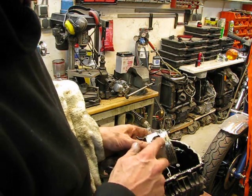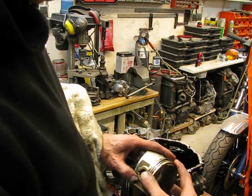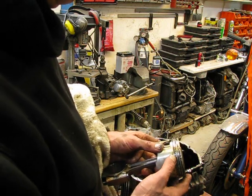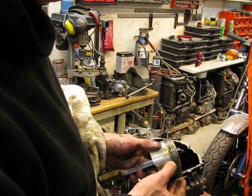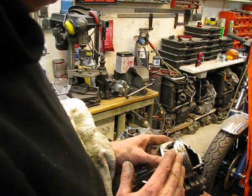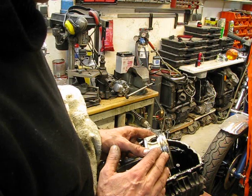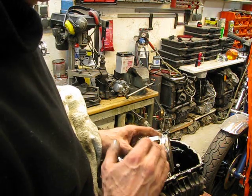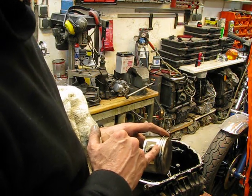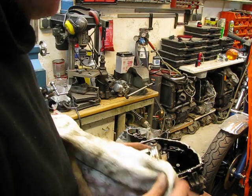Then the pistons. You can see the piston rings are clogged to the piston itself. And when I go to drive this, there is no compression. There is the oil — oil scrape rings are also seized. This is also a problem. You can't buy new ones, maybe in America — there is one guy that has them. I prefer to take them from a special car and cut out the groove inside the piston from 1 mil to 1.2 mil. The oil piston rings are the same and it runs very well.